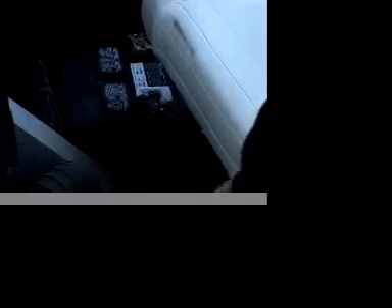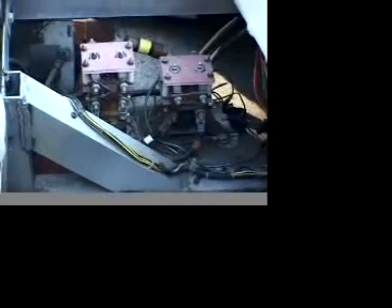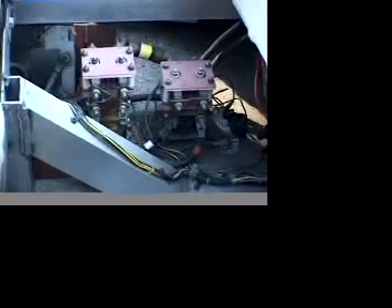We've got a 12-volt battery that controls and powers all the lights on the dashboard along with the running lights. The next thing down is the vent, which is the heat for the car, though it doesn't really work that well because electric motors don't produce much heat. What the vent is doing is bringing air across the motor, through the vent, and into your feet. The two components under the passenger seat are the two controllers for the motor. As you push down the pedal, they click — it's a three-stage controller.